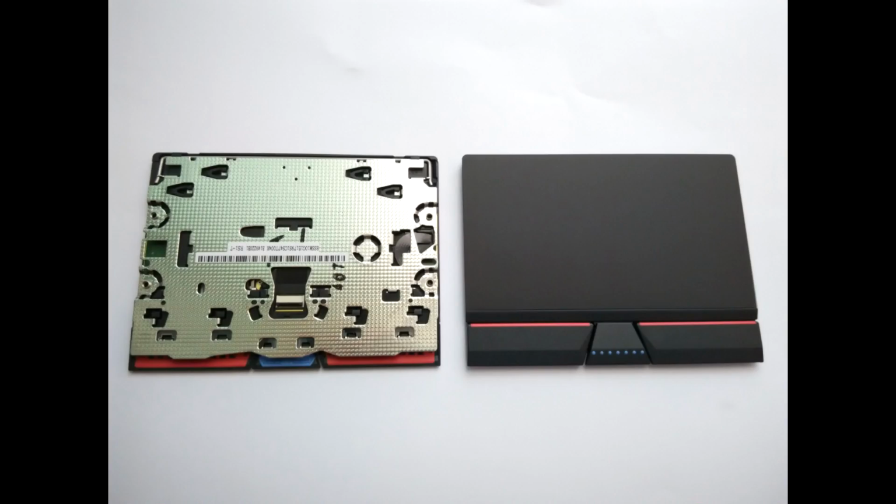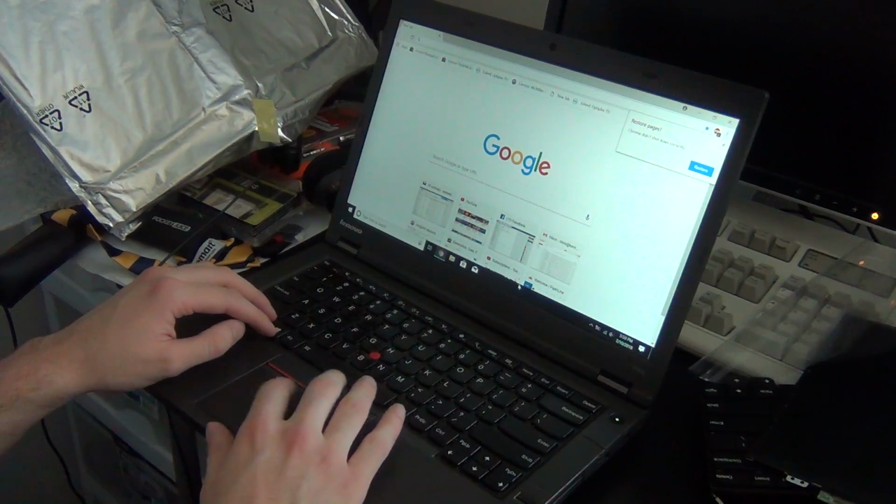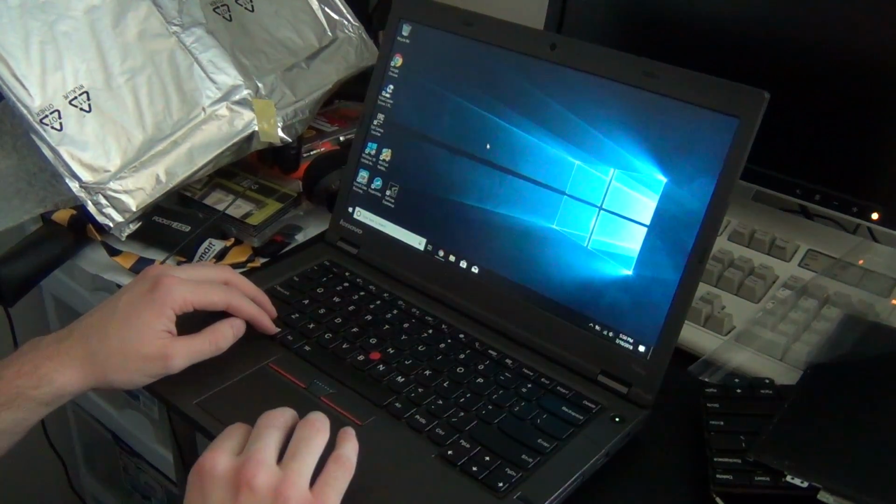Once you've installed the new TrackPoint, you might find that you need to reinstall the drivers or install different drivers in order for the TrackPoint buttons to work properly. I'm going to leave a download link in the description for the TrackPoint driver that worked correctly for me. Like I said, this will only work if you have the Synaptics touchpad.